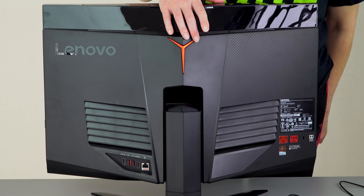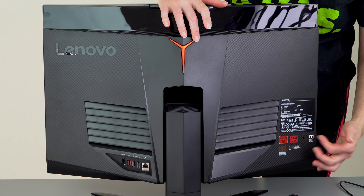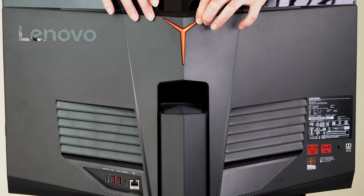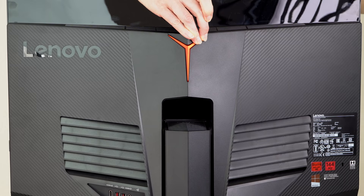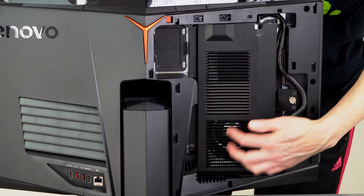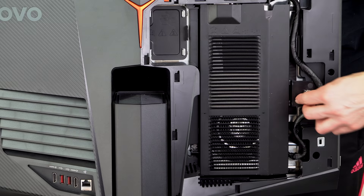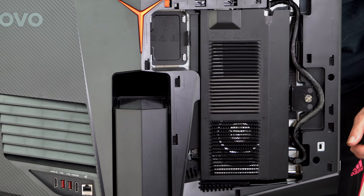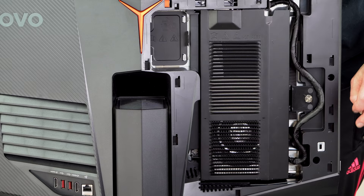The neat thing about this is how upgradable it is for an all-in-one. See the Lenovo Y logo on the back? It's not just decor — it does things. You press it on either side until you feel a click, because each of these panels is removable — that's how you get to the stuff inside. Once you press that in until you feel a click and push down, here's the graphics card — a big graphics card underneath the baffle. They say this is tool-less, so you don't need screwdrivers. You can see the fan of the GTX 1080 Founder's Edition under here, and you could upgrade your graphics card. There's a 625-watt power supply, which is ample for the future. NVIDIA has been trying to consume less power with each generation, so if it can handle the 1080 now with a quad-core i7 desktop CPU, it should be ready for the future.